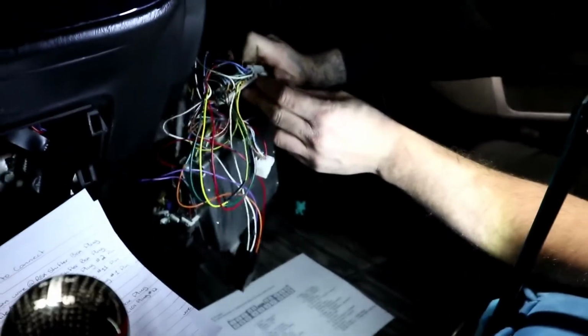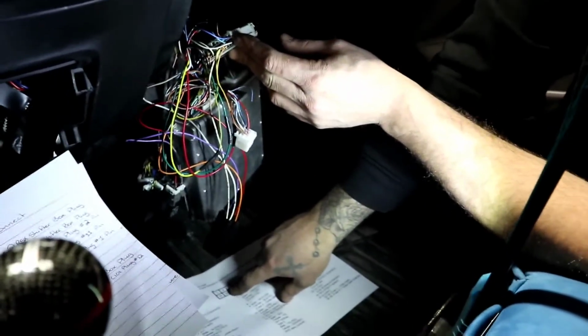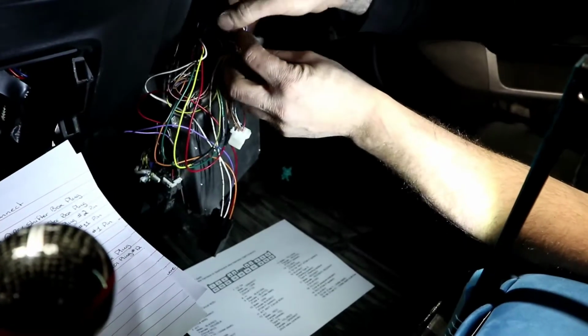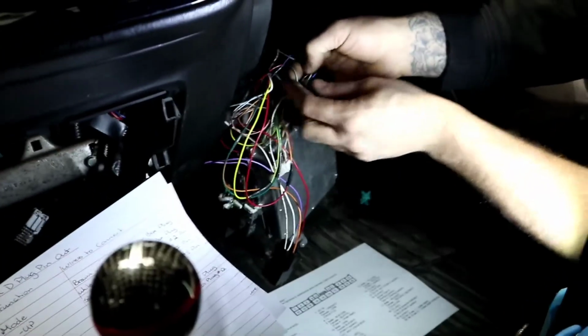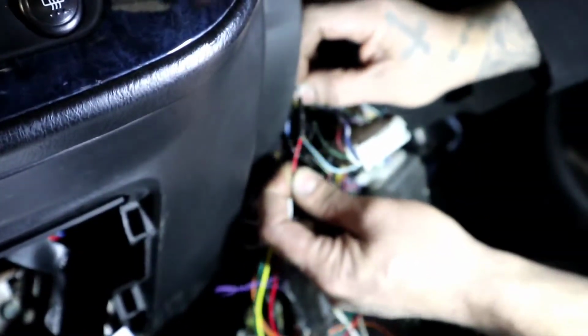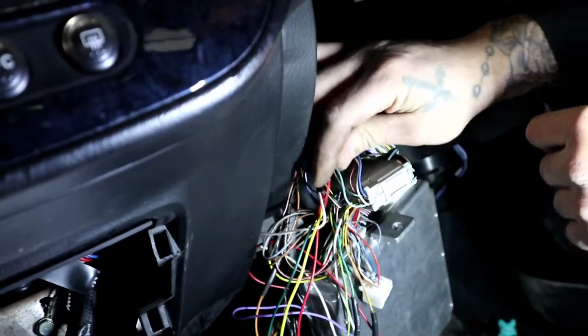So if we have the C101 plug, number 12 is right next to number 11, right? So if number 11 was the white one, 12 is gonna be the one right next to it. There it is, a light blue wire. So that light blue wire is gonna be spliced into that red. So you see the red spliced into that light blue wire? Yep. That's it. So have it spliced in, and know the difference between a connection and a splice.